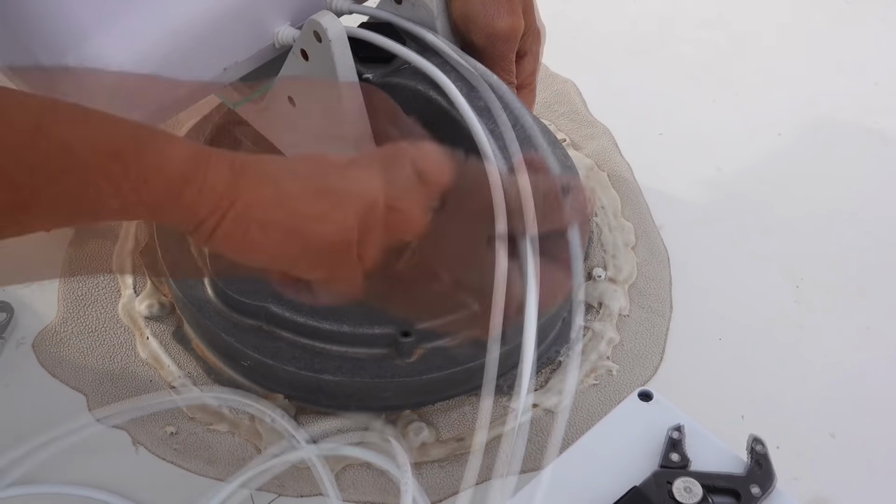Now we need to run the cable through this box. I already created this gland here to run it through, and I'm just going to loop it up, have a little bit of extra here in this box, and then run it down here. And I have an access point here that goes into the front cap of the RV, right on top of that electronics cabinet where the router is. This does rotate, and I want to have enough cable so there's enough when this thing goes around in circles. I'll just have to be diligent about not cranking it too many times.